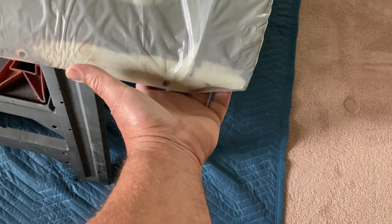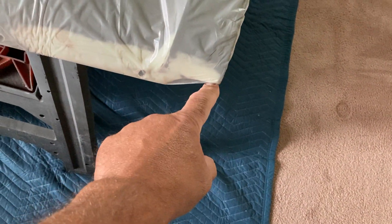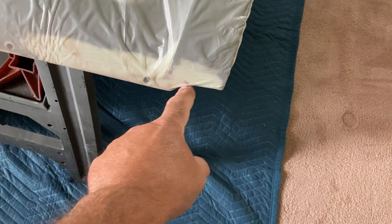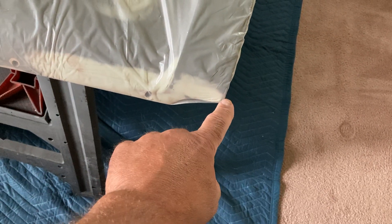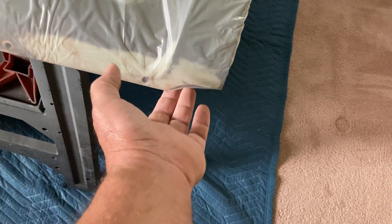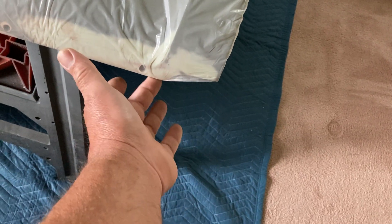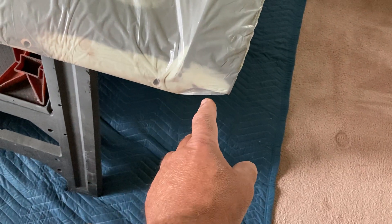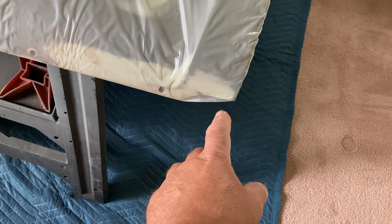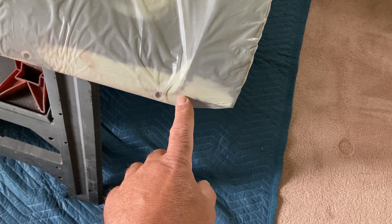We reshaped all of this. The back side of the hood — the bottom side — is the same for all years, but the front isn't. There was a notch cut out but it wasn't big enough for the '78. Pretty weird how they went halfway. So we came back and made it bigger; it actually matches the back side of the hood now so when you look at it on the back it doesn't even look altered. There was also a point that stuck down here — on the '77–'78 Gremlin they don't have headlight doors or surrounds.